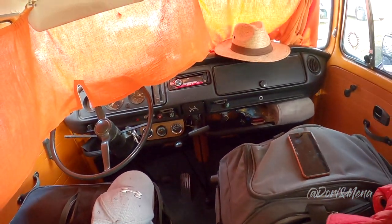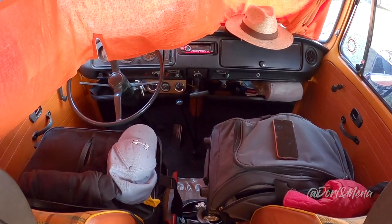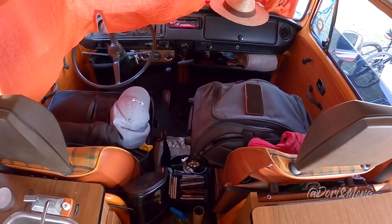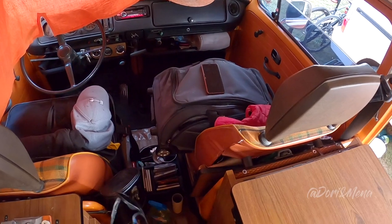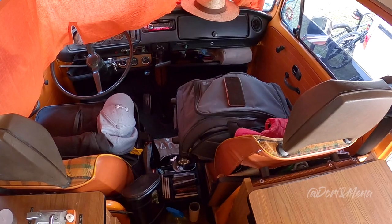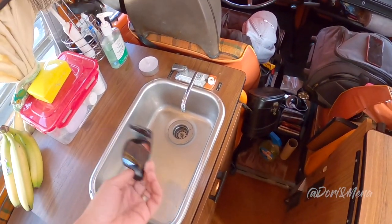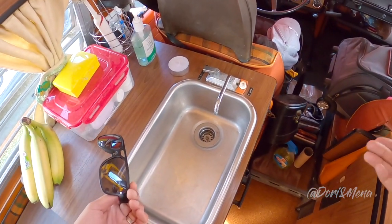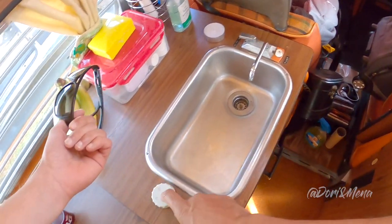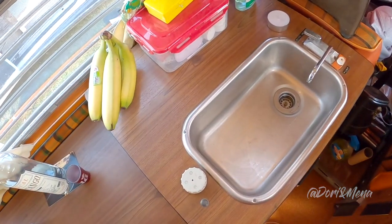We get here, put our luggage on the front, and just access our clothes as we need them. For wintertime, I just park it — I never use it in the winter. You just park it because the only water you have is this one tank and it goes straight down. In the fall, I drain it — there's a drain underneath — and I put some antifreeze in and run it until it's pink, then shut it down. That's it. Really easy.